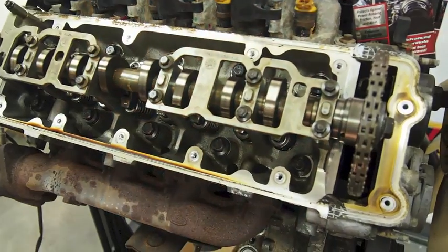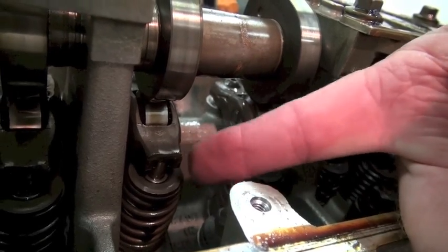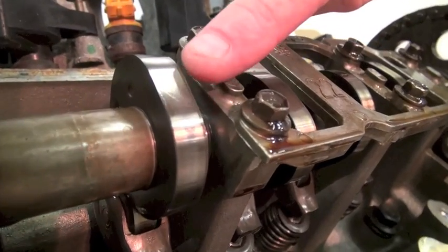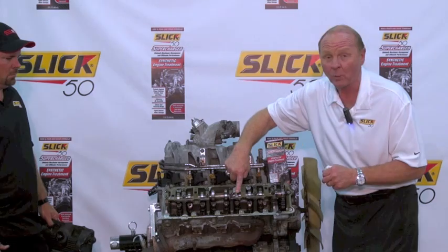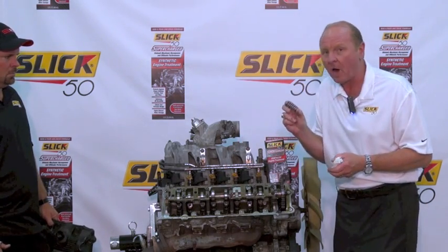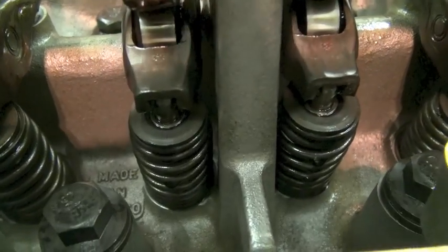Like all other V8 engines, you have two rocker arms per cylinder, two valve springs, and two valves. Right here on the cam, these are the lobes — and that's where you're really going to get a lot of wear over time. The valve spring is something that always concerns us, especially in a Sprint Cup Series engine, though you won't turn this engine anywhere near those RPMs.